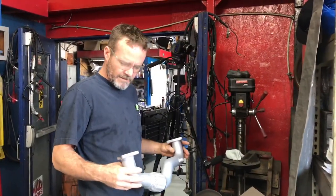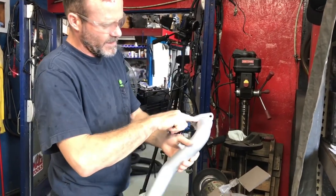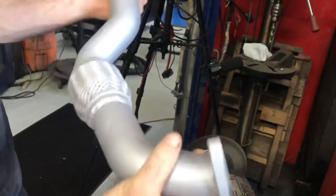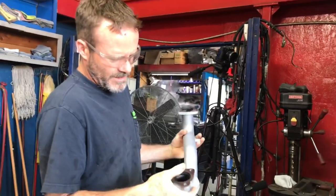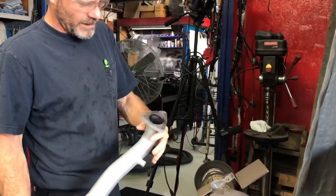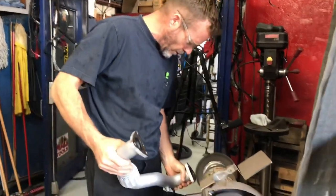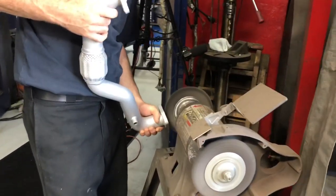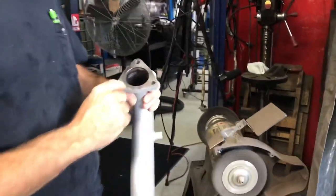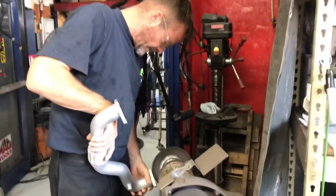So I'm thinking we might have to start buying new pipes. We actually weld these here too because I've had these come apart — we put little tack welds on here to hold the plate to it. It doesn't have to seal it because it seals on the inside; it just needs to hold it. I've had them blow apart right there. So we do a little bit of welding there, cleaning them up. They're just getting old now and they're harder to make look good — we'll have to machine them. I haven't even checked to see how much. See this right here — all that just from being old and from welding it.